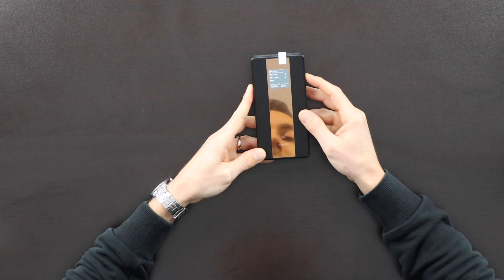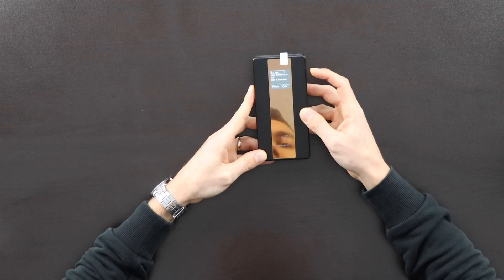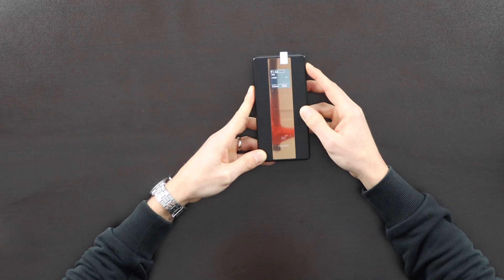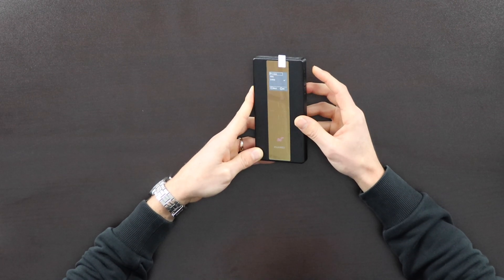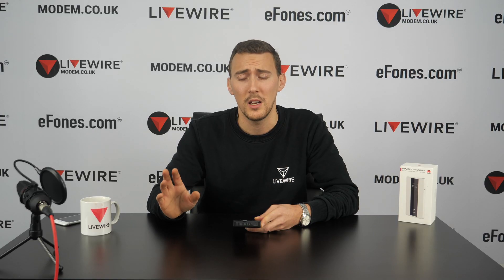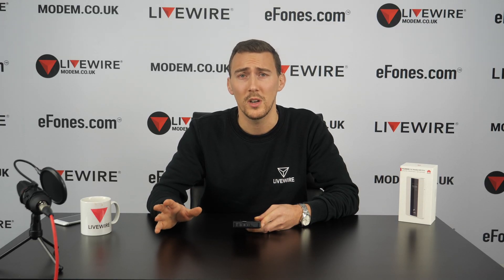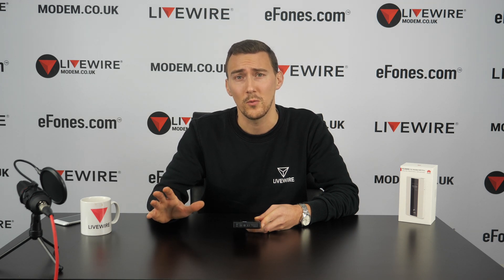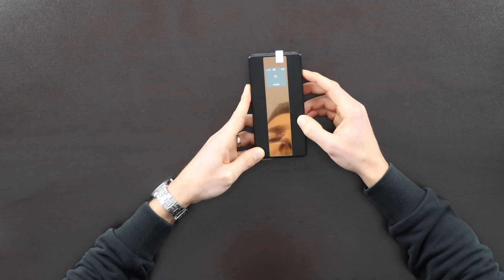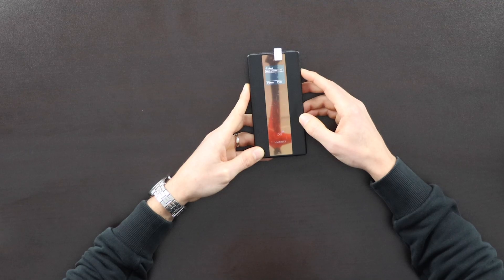Going into Wi-Fi settings and pressing the power button takes you into sub-menus. Under Wi-Fi info, you can see the SSID, SSID password, and Wi-Fi band - in this case it defaults to 2.4 GHz. There's also WPS: if you're connecting a laptop via Windows 10, click the device's SSID in the Wi-Fi list and it should offer a WPS option. Activating WPS causes the device and laptop to talk to each other and connect automatically.